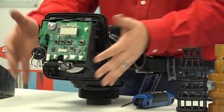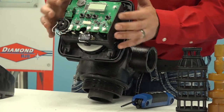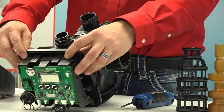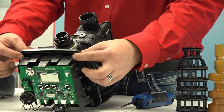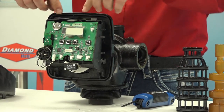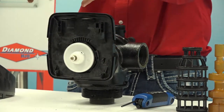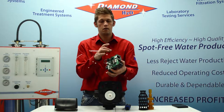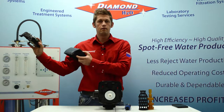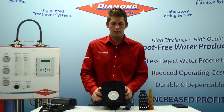This unit obviously is not plugged in. What you're going to do is remove any cables that are coming through your back plate. Your motor cable will stay plugged in; any other cables are going to be unplugged. If you look at the front of your display, there's a space up top for your index fingers. Put your index fingers in these slots and flip these tabs up with your thumbs. That'll bring loose your drive bracket. With all your wires unplugged, this drive bracket — including your circuit board — will come undone. I recommend taking your cover and your circuit board drive bracket assembly and moving it as far away from where you're working as possible, so as not to get it wet and not to knock it off the brine tank.